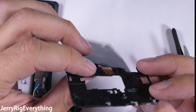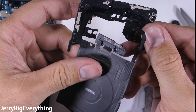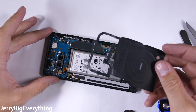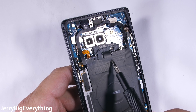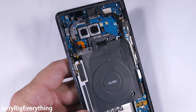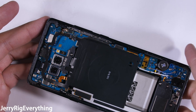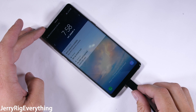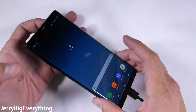The wireless charging has one little component at the top that is a battery temperature sensor — this is excruciatingly important. Without this your phone will not charge, so it needs to be left intact. I'm just going to cut around the golden contact pads leaving everything intact but the plastic, since I want all the features to remain functional. You can see the leads under the black material that go from the battery temperature sensor to the motherboard. If you're anti-wireless charging you can cut around those leads leaving them intact, but if you damage that sensor your phone will never charge again. My phone is turning on and still functional, and it can still charge, which means I didn't damage that battery temperature sensor.